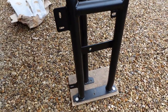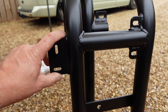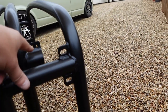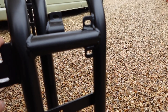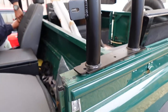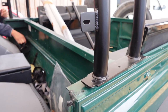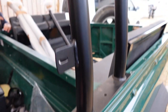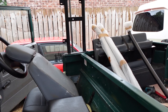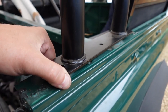The two-bar hoop is the one that goes at the front. You can see this is for the channel, which attaches the channels above the door. You've got your seatbelt position here and brackets at the top to connect everything up. We haven't opted for additional seatbelt bracket mounts on the rear hoop for forward-facing seats because it's got inward-facing benches on this one. The trick with these bars when you're doing the fit is you don't do anything up tight — you do it all loose. Otherwise you get yourself in trouble because there's a bit of distortion; even though these are made on a jig you're going to get some distortion.